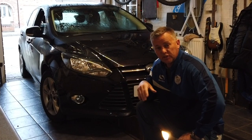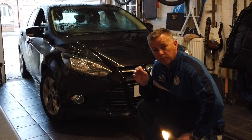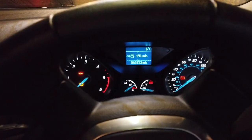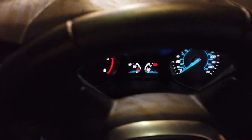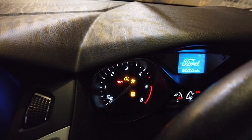Pretty much 90% sure, but we'll do some final checks to make sure that's the problem. When you come inside the car - and this is the bummer - it's only done 45,000 miles, it's not done much, it's been well looked after. But we turn the key, press the clutch, turn the key - clunk clunk. All the lights on the dashboard come up good and strong, they don't dim when we turn the key.